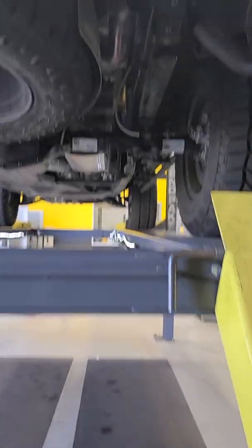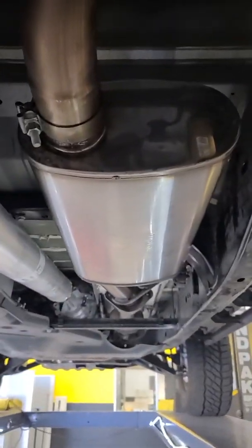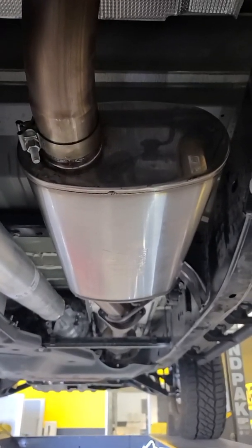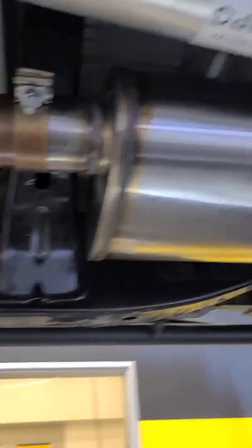Take a look here — you're going to see it still has the high clearance tailpipe. The rear of the muffler is going to look a little different than the other one. You can see it's very similar: it's a 5x11x22, which is that larger casing like we use in the standard system, but we've had to move the inlet slightly to accommodate the new design.